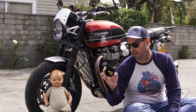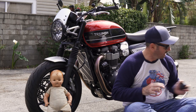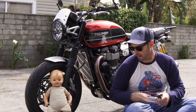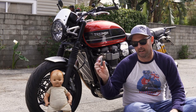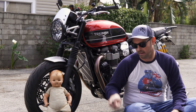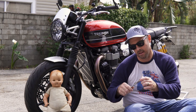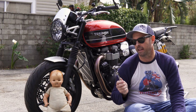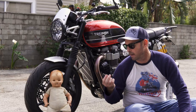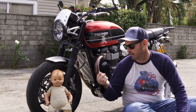This thing did not work very well for the Triumph stock filter, the OEM filter, so I ended up having to use this — it worked fine. My new filter has a 17mm socket; you just don't want to crank the crap out of it, but it snugged it out and that worked out better actually — it'll be easier to get off later. My aftermarket oil cap is a 10mm, and the drain plug is an 8mm hex.